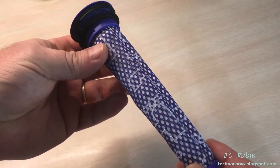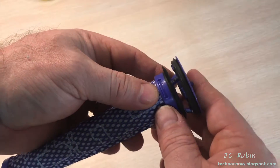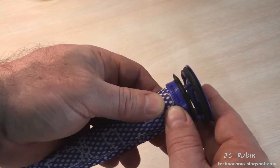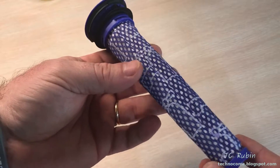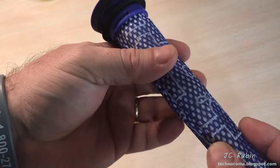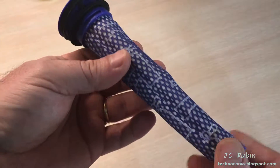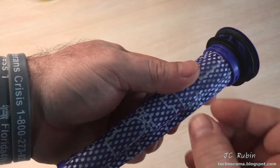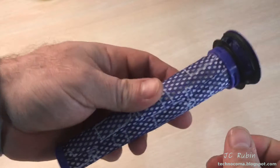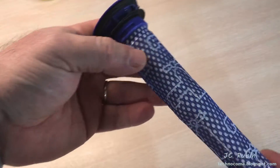This pan doesn't have a lot of surface area compared to the filter. On the pan it's easy to simply scrub away and remove the minerals, but you can't scrub away minerals that bind to the individual pieces of fabric within the filter. If you live in an area with hard water — and pretty much everybody has some mineral content in their water — the filter gets wet, it's left out to dry, and the mineral deposits dry up within the fibers of the filter, substantially reducing performance.